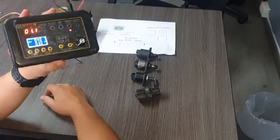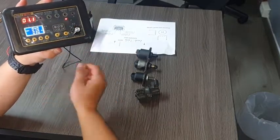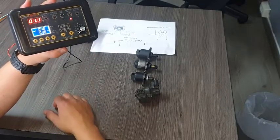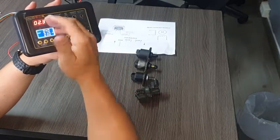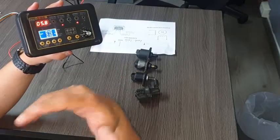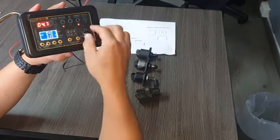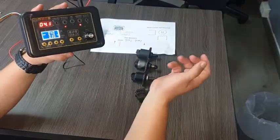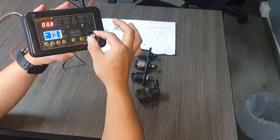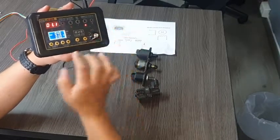Just by connecting the device it is ready for working. The first screen — this digital screen on the left in red — is a voltage output screen you can use for testing sensors that work with five volts or 4.5 volts. You can make a direct test of different sensors using this voltage-regulated line, adjustable as per your requirements using this potentiometer.